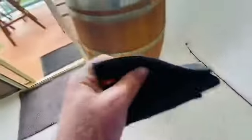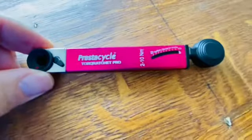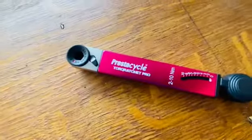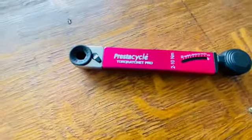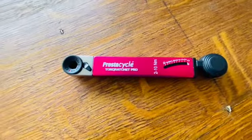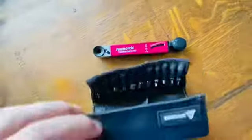Multi-tool knife kit — pliers and a knife, just to get you out of strife. A new little setup for my torque wrench — it's a great little torque wrench, 2 to 10 Newton metres, small and lightweight. The recommended tension for the seat is about 15 Newton metres so it's a little under that, but I've been running it at 10 Newton metres and haven't had any movement, so it's fine. Comes with extension tips and all the bits I need for my bike setup — nice, small, compact, lightweight.